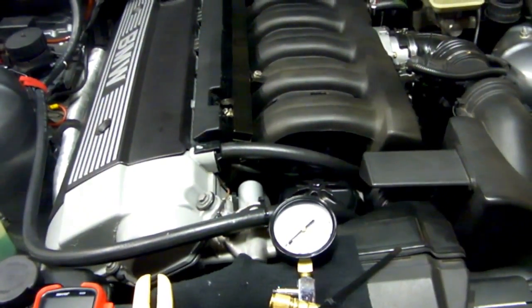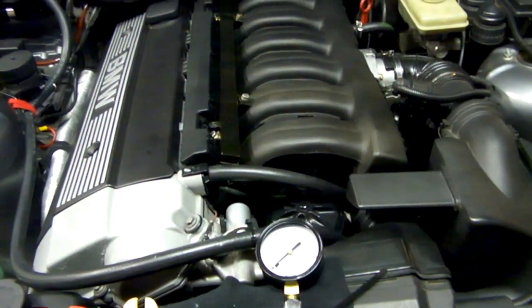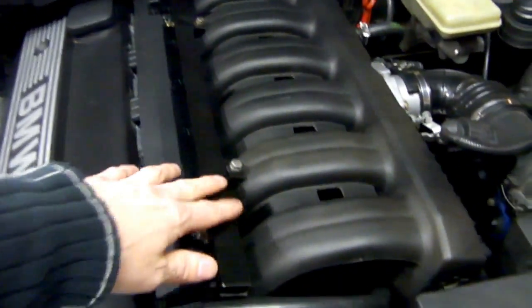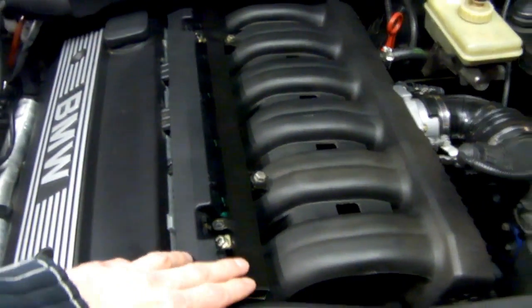It's in what's called a 3-to-2 control valve, which recirculates unused fuel back to the tank, so it's not traveling through the fuel rail all the time — which heats up the fuel and causes more emissions. Basically, in a nutshell, it's like a returnless fuel system.